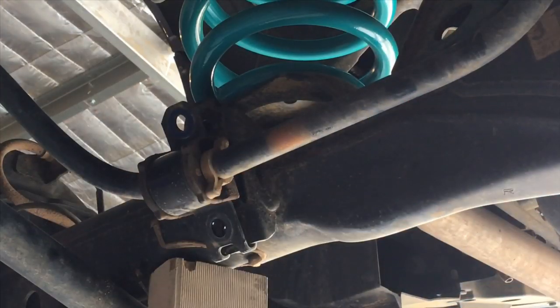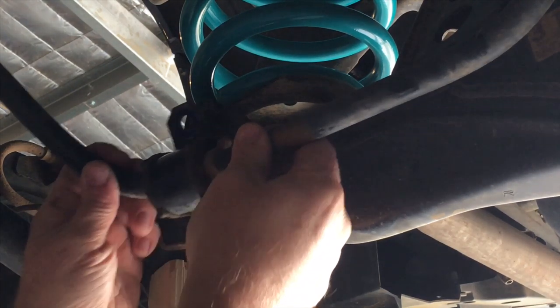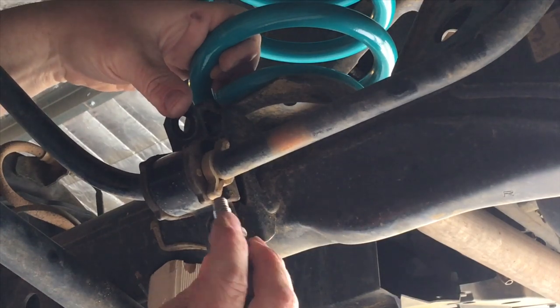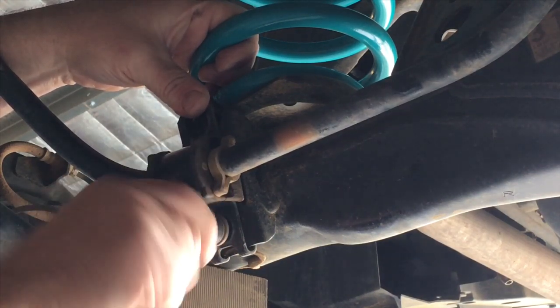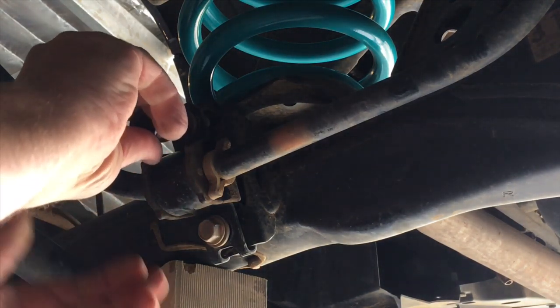Okay, so now that we've got sway bar in place, I've just moved it to the side. As I said, the timber's here, just enough pressure so that it takes all the weight from hanging the bottom there, so you can move this around a little bit to get the bolt started. And the best way is obviously always make sure you get it, even though they've got a taper on them, you could probably hit them with a rattle gun like a madman, like people do, and get them started, but I always want to make sure that they're started right without any load on them, right?